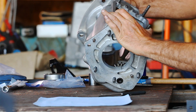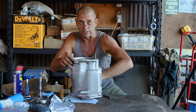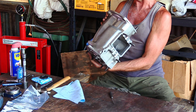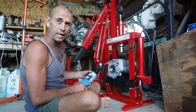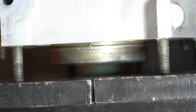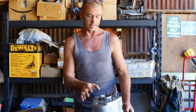The bearing is going to be on the inside of the box. What I'm doing here is bashing up that housing quite a bit so it's lined up with the dowel, and I think just to push it through you're going to need something softer. So that hammer technique you saw me deploying earlier — don't do that. That's just vandalism. Save yourself pain, heartache, and money. We finally got that circlip in. My pliers couldn't even open it wide enough to slot on, so we had to use some unconventional methods.